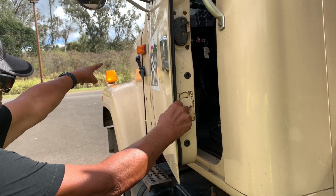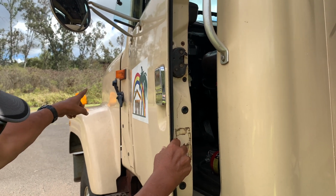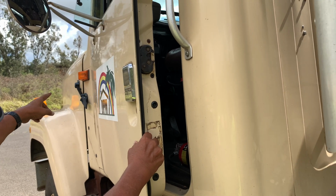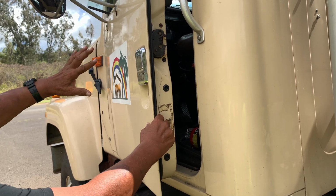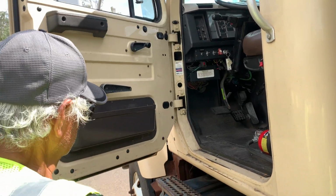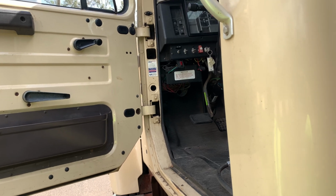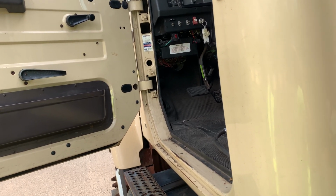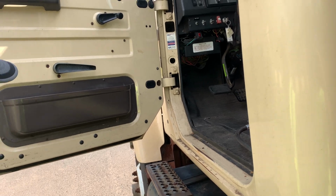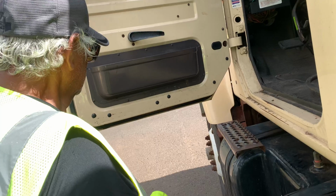I've got a turn signal lens up there. Left, right, left, four-way service. On the door, there's no damage to the door. The door hinges, all the bolts are present. They bolt the hinges to the cab and to the door, not bent or cracked. The rubber seal around the door is tightly mounted, no cut, crack, or tear.